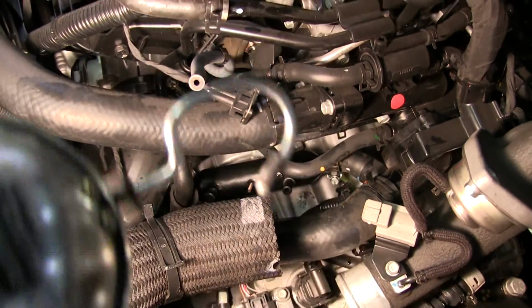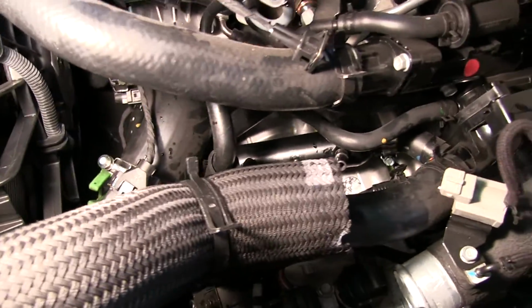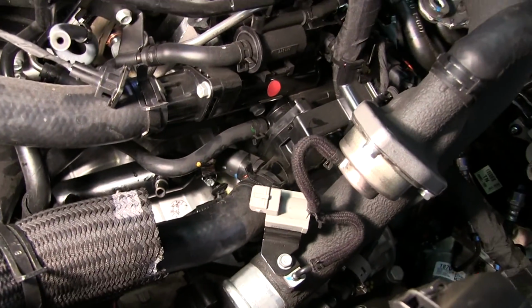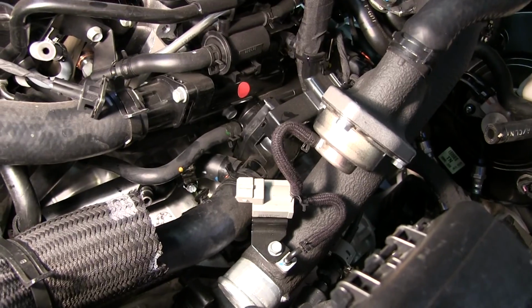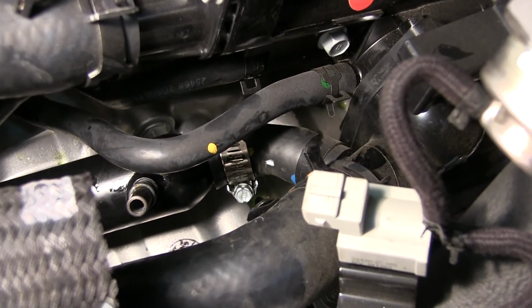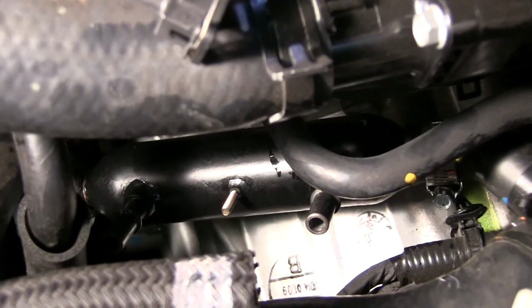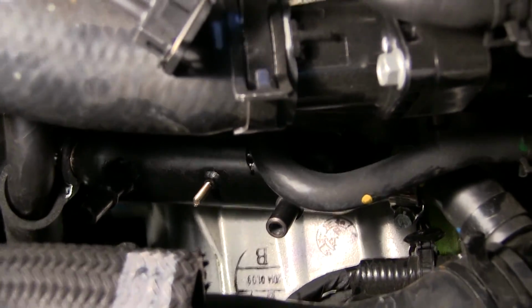While he's making a fuel hose, we're just going to go a little bit more light, to be able to show you a little bit better of where the fuel converter is. See how tight of a fit that is? So you need to be real careful if you're doing this install on your own. You need to make sure that there's enough room. And you can see that we're looking at one of the fuel intakes on the fuel converter there. There's your ground line. There is the other fuel outlet, tucked way underneath. It's very difficult to get to, but you can see down there they crimped off so we don't have antifreeze flowing everywhere.